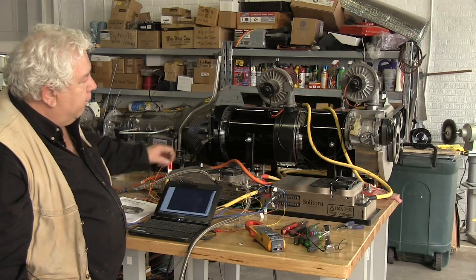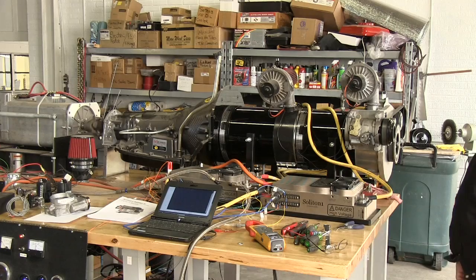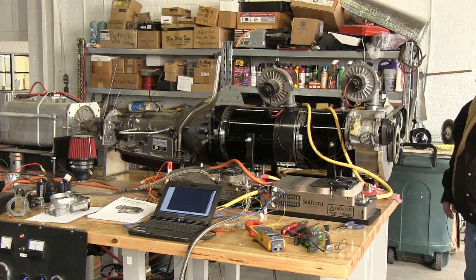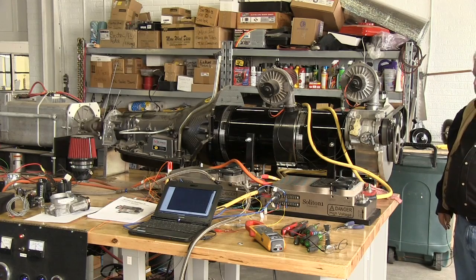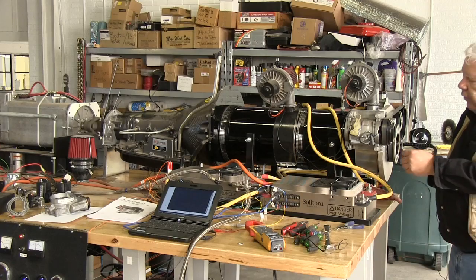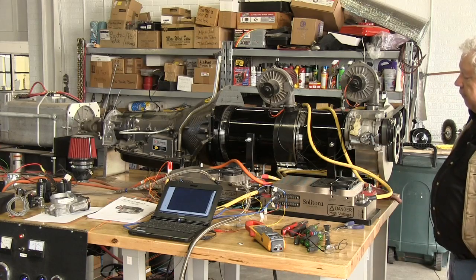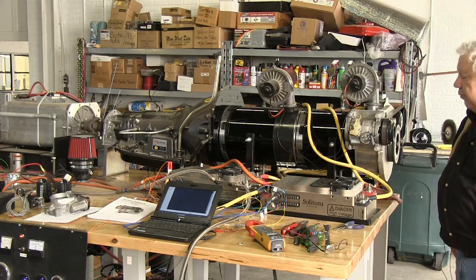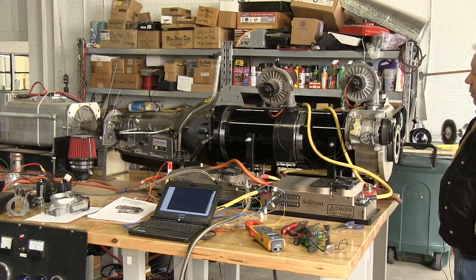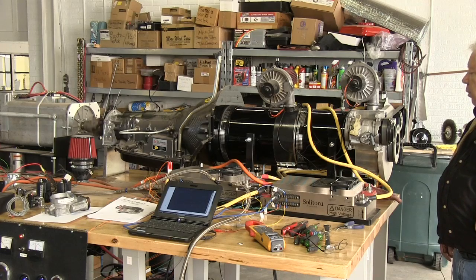And our little front end thing is running very smoothly with our belt and our pump. Something's rattling here a little bit, but not too badly. And you can see our reluctor ring spinning, and our air conditioner, of course, over here. Now this is our connector for that. We'll use the engine control unit and environmentals will still signal this compressor just as it always did to engage the clutch here to actually turn the compressor. We're not turning the compressor right now. We're just turning the idling ring here. There's no load on this.